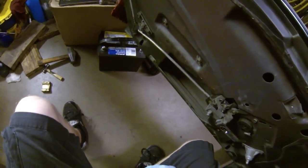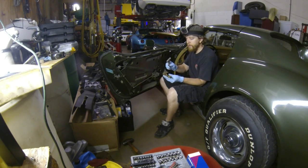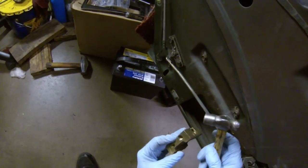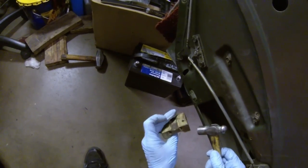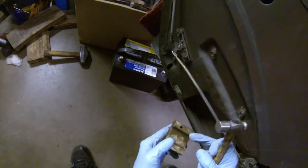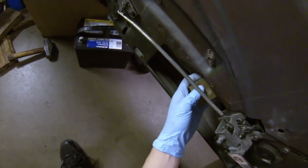You don't have to go to a non-factory oversized bolt. What you're going to need is a dolly and a hammer. This is a brake block made of brass — usually dollies are steel, but this is a makeshift thing that works really well. I use this for pounding on things I don't want to mar up and damage. It's got this little ledge here that's going to work really nicely.